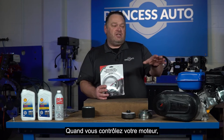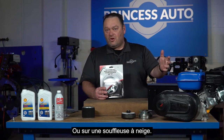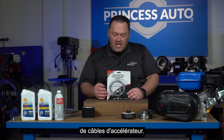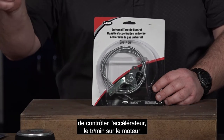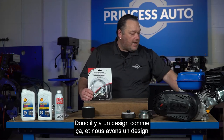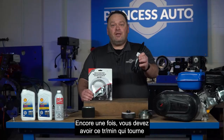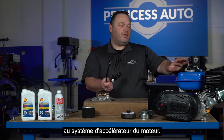When you're controlling your engine, maybe you need a throttle cable system. On a lawnmower, you've got your throttle — maybe it's on the side, or on a snowblower, or on a go-kart you've got a pedal. You need to be able to control the rate of speed of the engine more remotely. We carry a few different designs of throttle cables — some are pretty standard for lawnmowers and that kind of stuff. The throttle cable allows you to control the RPM on the engine more remotely. There's a design like this and a plastic design — you'd see something like a rabbit/turtle icon for fast and slow. They have simple linkages that connect into the throttle system on the engine.